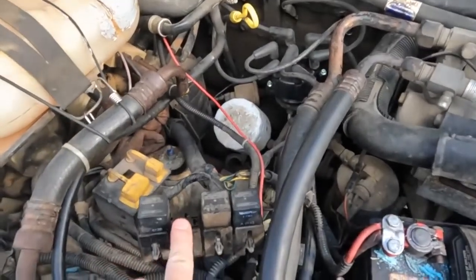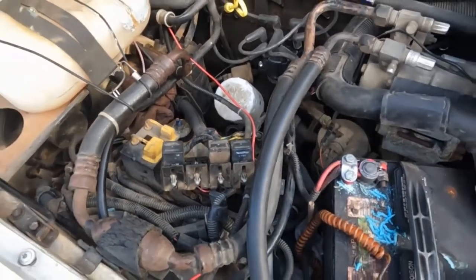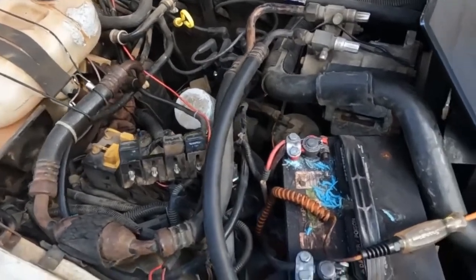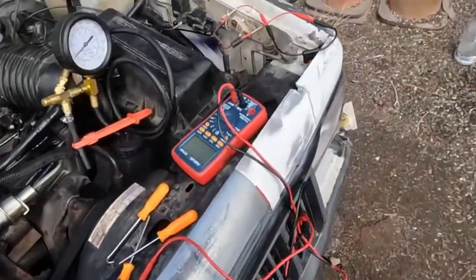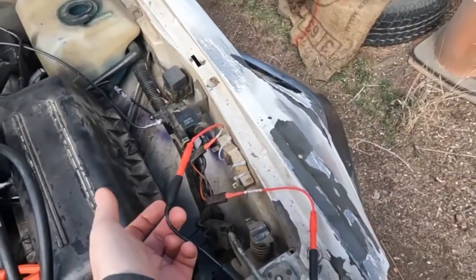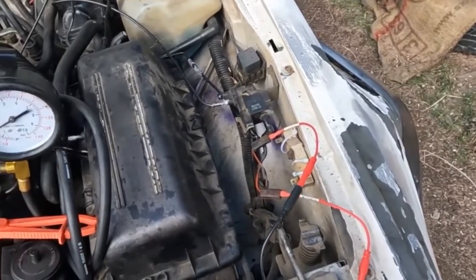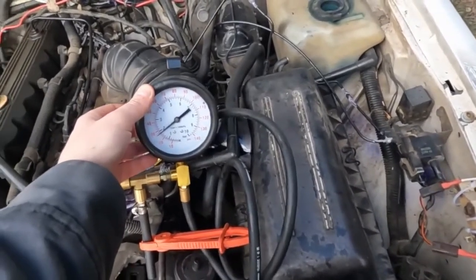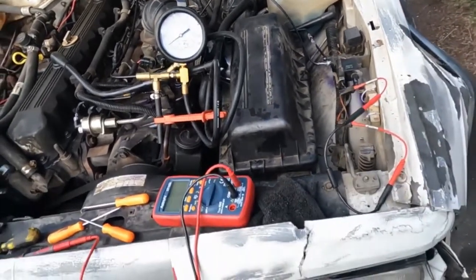According to the manual, this is the fuel pump relay — it is pulled out. I started it up to check some things and it's running, so it's running without the fuel pump relay. I also went over and bypassed the ballast resistor. That's all I've done — and we're still a little low on pressure, but this is definitely different than it was acting before.